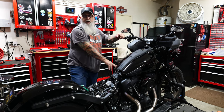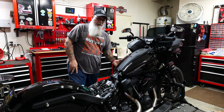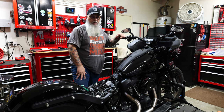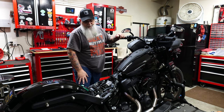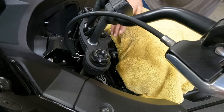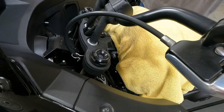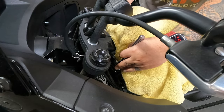Then there's a vacuum hose and a quick-disconnect fuel line. There's also a plug up underneath the tank. I'm going to put a towel over the front of the tank to cover it so nothing happens to it when I'm getting that bolt loose. We're going to leave the bolt in there, take the bottom one out, and flip the tank up so we can disconnect everything. You've got this bolt that goes right through here — that's for the front mount of the tank. It's a nine-sixteenths acorn nut and a five-sixteenths hex bit.